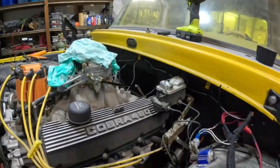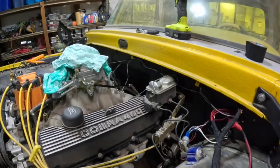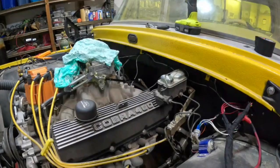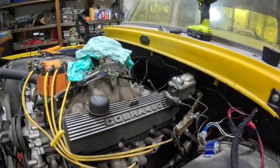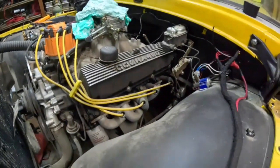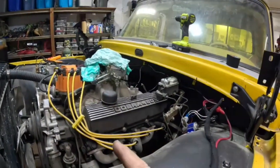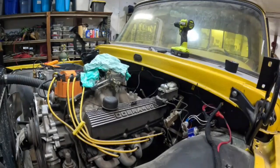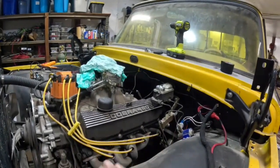I gotta put the snap ring in the back one, and it's good to go. So we can mark throttle off our list. We gotta tighten one, put a vacuum plug up there. And the carburetor part's good. You gotta cut them zip ties when I snap that little snap ring on. Tighten up that 1/2 inch bolt. Tighten up that valve cover bolt. And I think that part's pretty good.